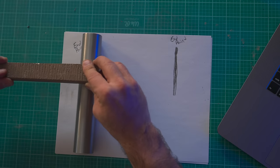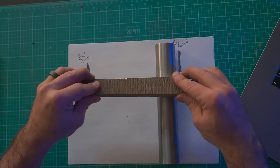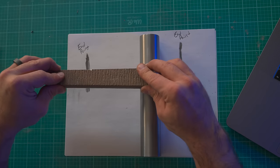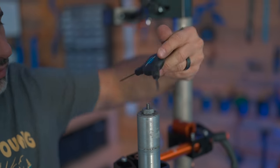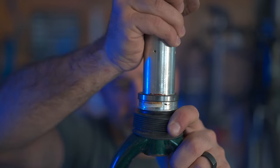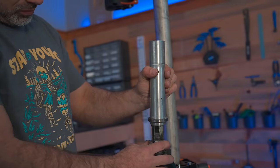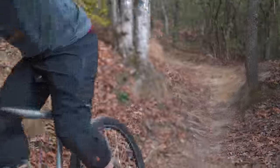Another common issue was bearing migration. You can see here that on each revolution, this pipe just kind of ends up in the same spot. But if we do this thousands and thousands of times, eventually it migrates — somewhere along the middle of its travel the bearing is in the wrong spot and you would have to reset it. That would involve taking this entire fork off the bike, disassembling it, pulling out the damper, and then topping out the fork and pushing the bearing back into the right place. And if you rode your bike really hard, this would have to be done fairly often.